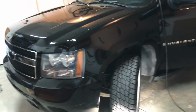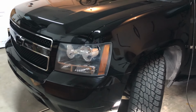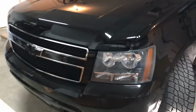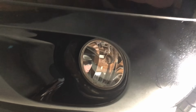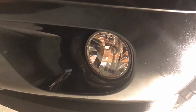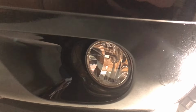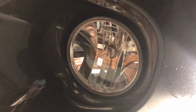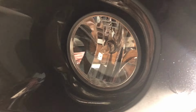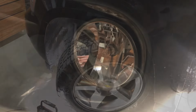In this video we're going to show you how to run all the cabling needed to install fog lights in the factory location. Now what we have already installed is the light itself, but it's not wired to anything. If you have a blank there, typically you can order these lights. I'll post in the description the kit that we're using today, but essentially it comes with two sets of fog lights, and you just pop those blanks out and these pop right back in their place. We're going to show you how to pop those blanks out, how to wire up your new lights, run those cables, and do a little test for you.